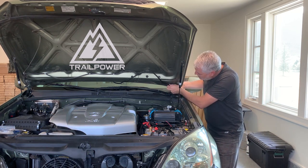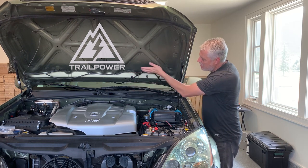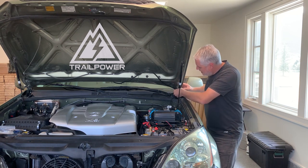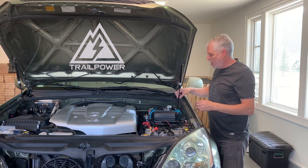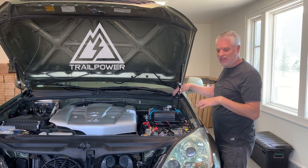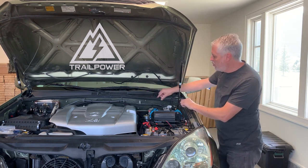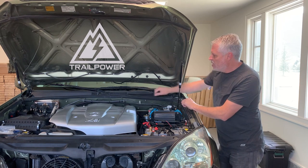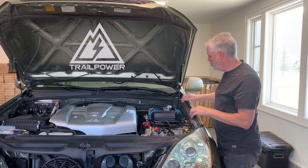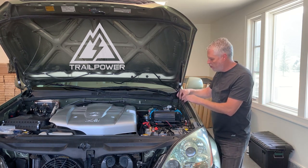With that zip tied in place, we've now got our cable running from the top of the hood on the outside, up around the inside, under the insulated cover, down to the hinge, tucked inside the hinge, and up here in front of the firewall. To get it from here into the engine bay, you'll find a rubber boot along the hood and another piece of rubber molding along the side — right between them there's a gap, and we're going to run our wire through that gap.